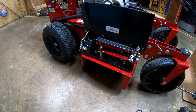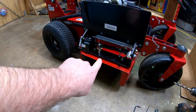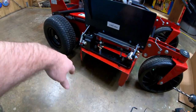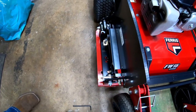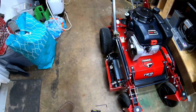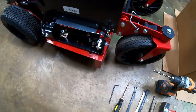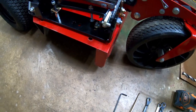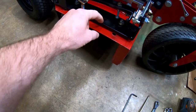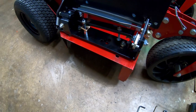I don't have a side mount catcher on this mower, but I do know with my Z3X mowers, and it looks like with this mower as well, you would easily be able to use a side mount catcher with this in the open position without having to remove it — which is a big plus. So if you look at the side of the mower here, when this is open, it completely gets out of the way of the mower. So you've got the area there to put your side mount catcher bracket on and still use that. With those spacers under there, you've even got a quarter inch of space underneath it, so if your bracket's a little bit wider, it can slide up underneath there, depending on what type of bracket you have for your side mount catcher.